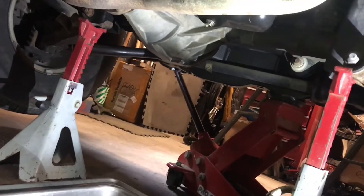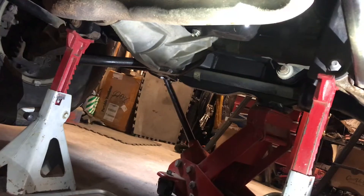This is a 2000 Dodge Durango 5.9 liter with a 46RE transmission. I did a torque converter swap, put in an upgraded valve body with a heavy spring valve - whatever - it didn't do the trick. After more study online, I found that with the plug taken off the transmission, if the torque converter still locks up, it must be because the torque converter seals are bad inside.